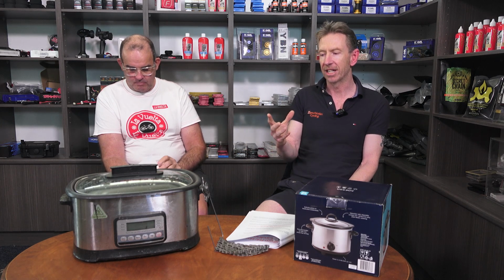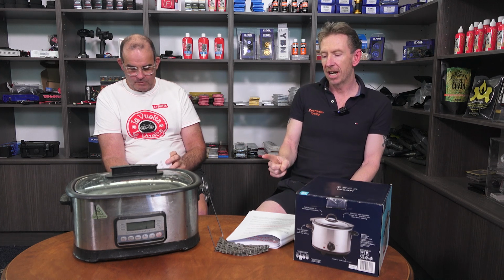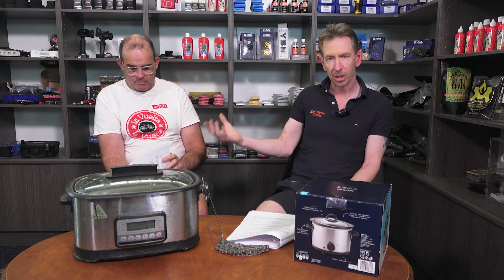But I've had a few of these come up recently where people are saying, look, I really love the waxing, but it's not actually getting through my training rides. I'm going out for 3 or 4 hours and it's just solid wet basically all the time, salted roads, and my chain's getting really noisy, and it's just not lasting through my training ride. What should I do? So it is pretty similar. Either, again, just top off with one of those wax lubes, so you can rewax as normal, or do a boiling water flush rinse and rewax as normal when you get home.